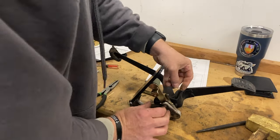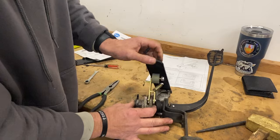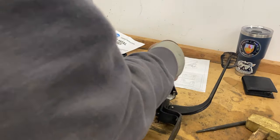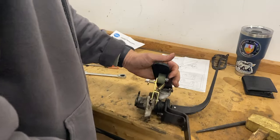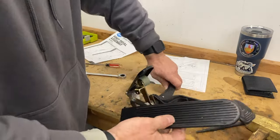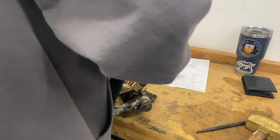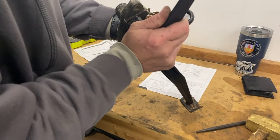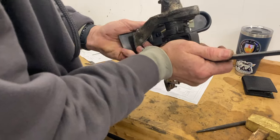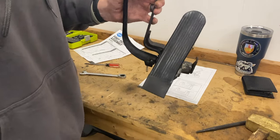Getting the tools out of the way. We'll get a 13mm wrench and tighten that down — this does have a nyloc nut. It's an upgrade in the sense that we didn't actually have a rubber pad on our pedal before. Make certain everything is overlapped on the back sides and that our pedal pad is secure. Just like so. This guy's ready to go back in the car.